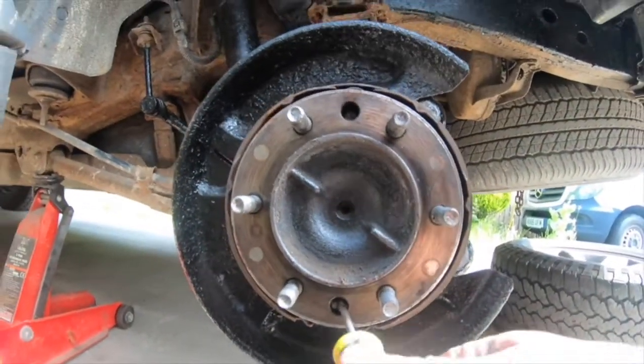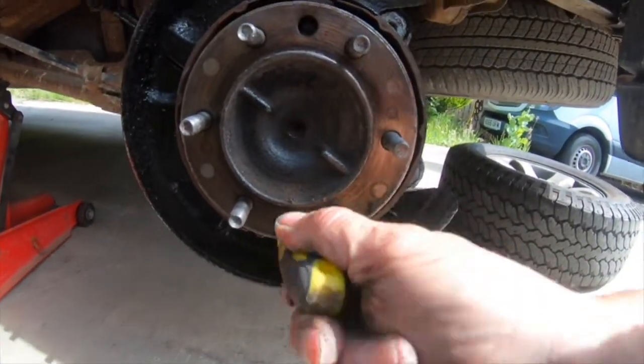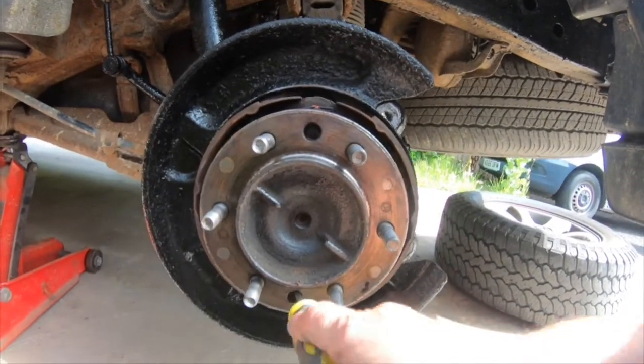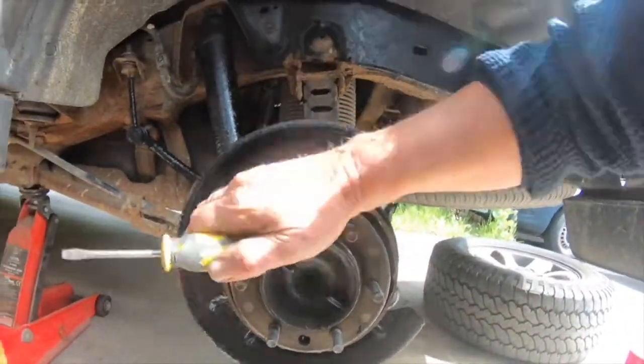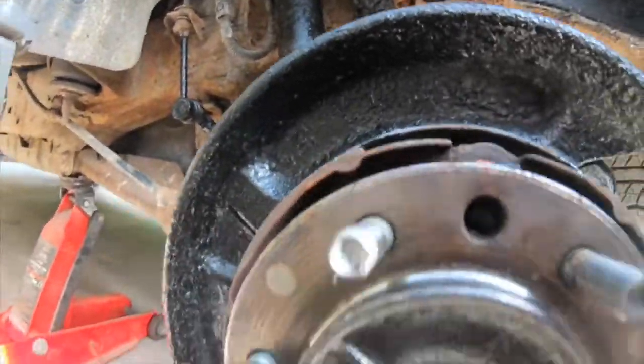so that you can get a small screwdriver, and they're normally pretty free, and just adjust it one way or the other. So if you go down that way, that winds them right off there, so they're right in now. Both shoes are right in. Then next, what we have to do,